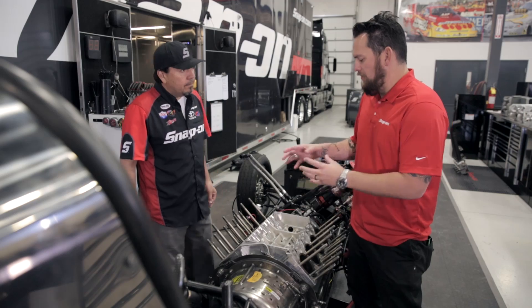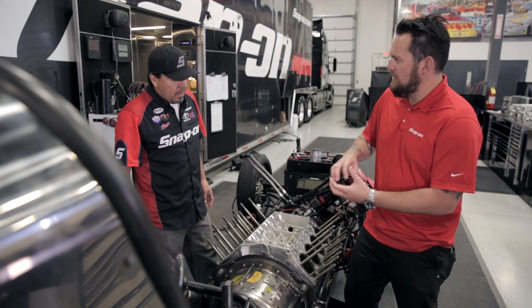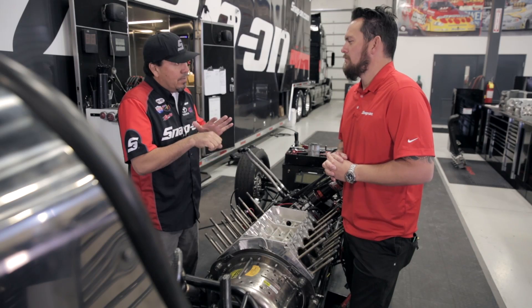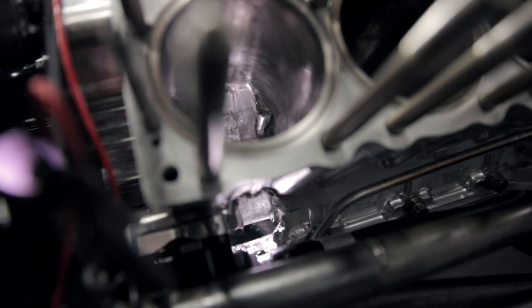If you're going to have a faulty part of the block, it's designed to kind of take that portion out. It doesn't just completely grenade it. One of the weak links — the rods occasionally will break. They have little soft areas on the side where the rod can pop right out, so we actually minimize the damage and make it easier to repair later on.